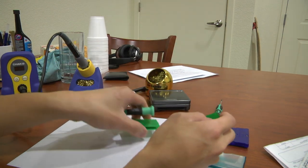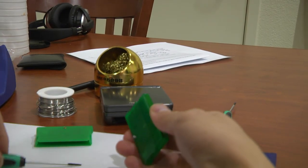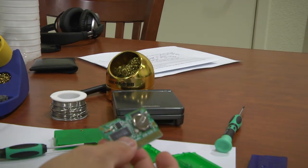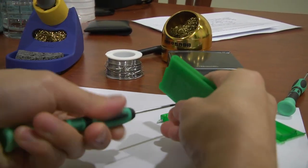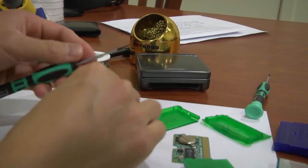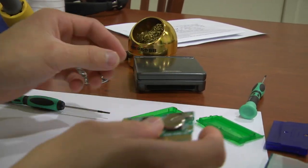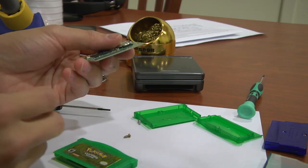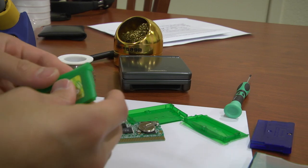Let's open up these two cartridges and get on with the video on how to change the internal battery. The screw is just a standard little star screw triangle kind. You can use a simple flat head to actually open it up. Nintendo, if you're wondering why there isn't any slot to insert a new battery, you can tell by the triangle or star screw they're using. That meant Nintendo didn't want you to get into a Game Boy cartridge, but since it's a simple plastic screw, you can open it up pretty easily.